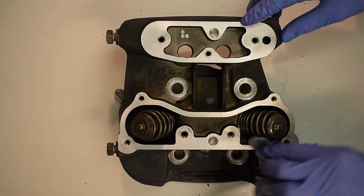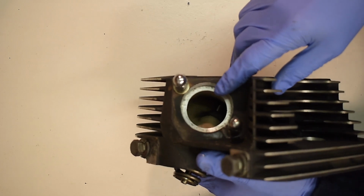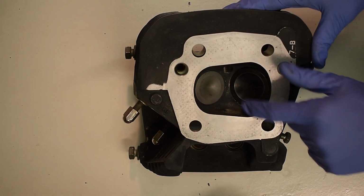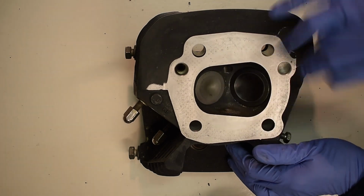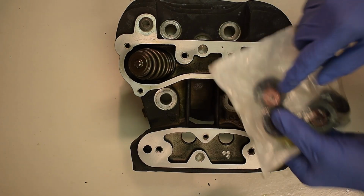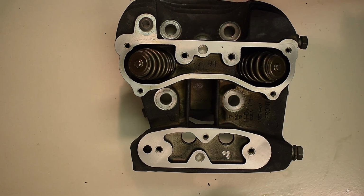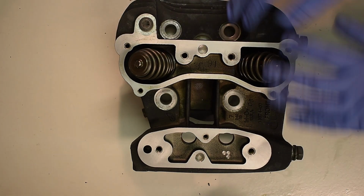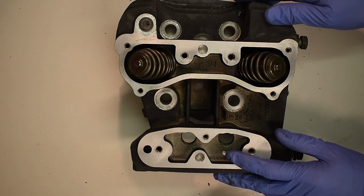Right, so I started with one of the cylinder heads and cleaned all this off, cleaned in there, and cleaned in the exhaust, pulled all that out, cleaned all that up, and then I decided to take the valves out and just make sure the seating on them was correct. And then once you've done that, because your valves have gone past the valve seals and the grooves in the valve stem might have cut the seal a little bit, it says really to replace them, because that's where oil can leak. So the whole thing started to become a bit of a bigger project than just cleaning it. So what I've decided to do is to make another video separate on just doing the head.